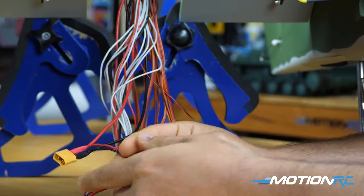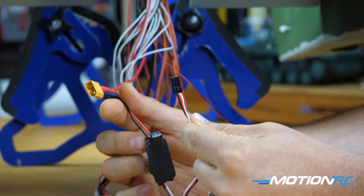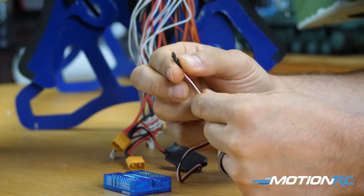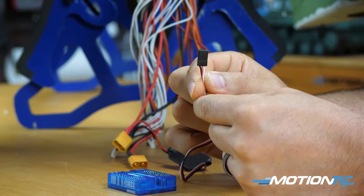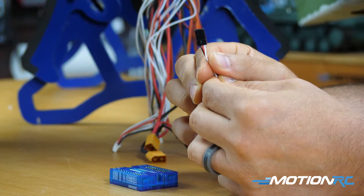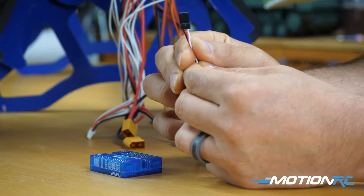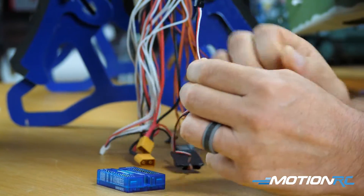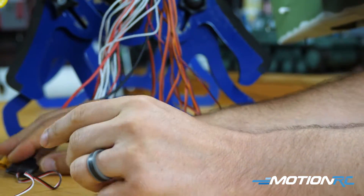What else doesn't need to go through the blue box: you're going to have two XT60 connectors coming off both ESCs into the motors - that's where you plug in your batteries. One of them has your UBEC off of it. Now for some reason people at the factory have been putting a throttle sticker on this UBEC lead - this is not your throttle. The lead coming off the UBEC is what's going to give your receiver power, so plug it into any open port on your receiver.